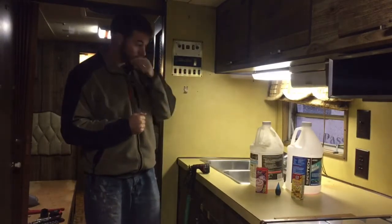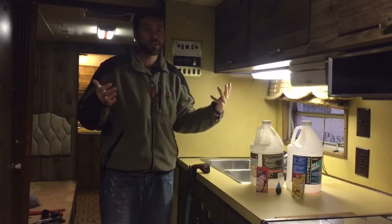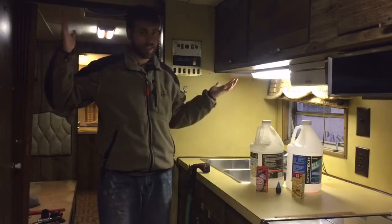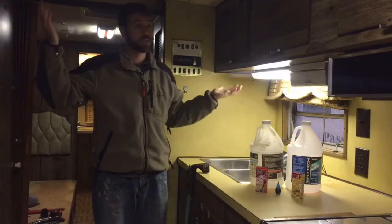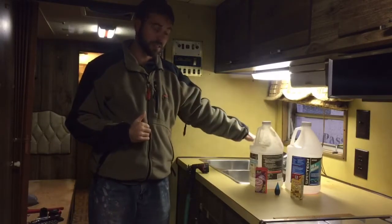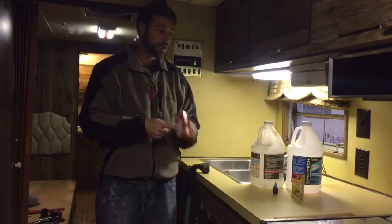Rather than use the freshwater tank, I'm going to just dump jugs of water down. And because I don't know which drains go to what tanks, and I don't know whether it leaks or not, and it's supposed to rain for the next 5 days, I might not see any water come out of the tanks that looks any different than rain, so I'm going to add food coloring. I'm going to add yellow to the kitchen sink, blue to the sink in the bathroom in the back, and red to the toilet.